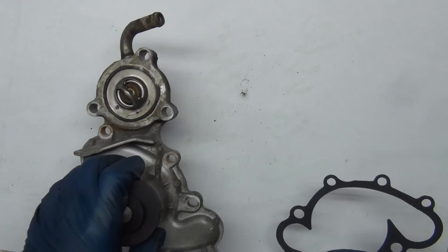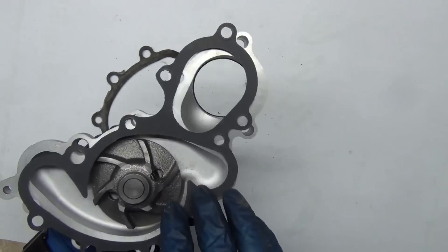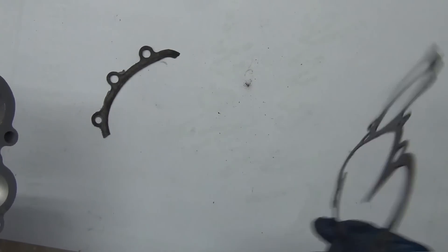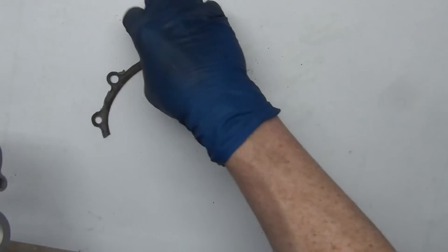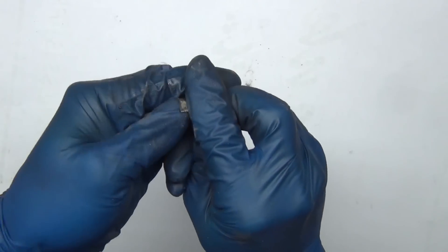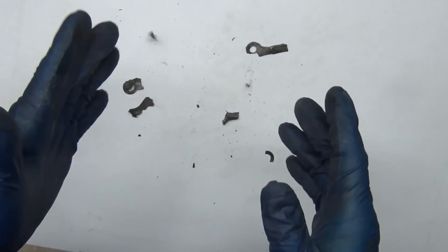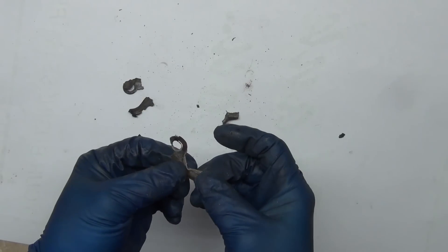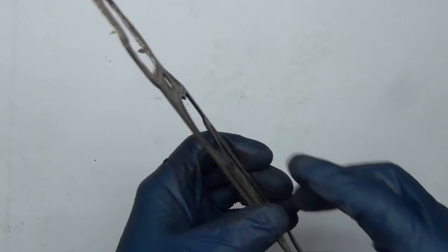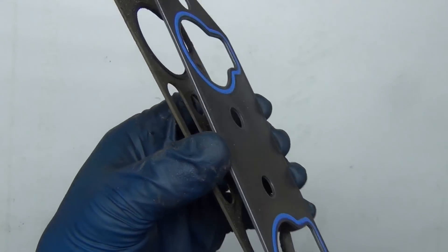We talked about lead and rubber — now let's talk about paper. This is the gasket for the new water pump. You can see it's the packing material that goes between the water pump and the engine, and it's pretty pliable. However, the old one — if I try to bend it, it just snaps. You can pretty much crumble it up into nothing. Paper is supposed to wad up; it's not supposed to crumble into a million pieces. It gets hot, it cooks, and just like ash when it gets hot, it crumbles up and breaks. This is the intake manifold gasket — the old one is really flat. This is the new intake manifold gasket, and when you look down the two of them, you can see the blue one still sticks up whereas the black one is just completely cooked.